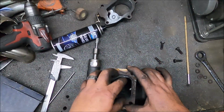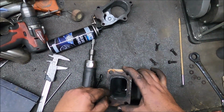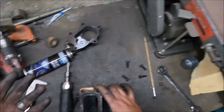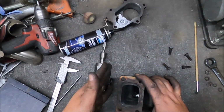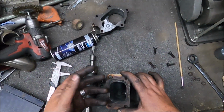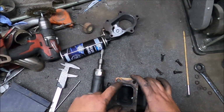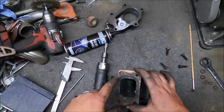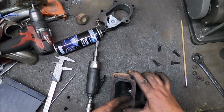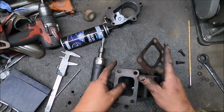Because the gas is flowing out, too big is better than too small. So it don't matter if I went slightly over, but things have to get bigger on the way out. Well, just as the flow goes forwards, it needs to keep going bigger, or at least a smooth reduction, because that's where the flat surfaces are bad. So going into here, it needs to be at least as big as the previous area. I'm just going to go off the gasket because I'm not sure of the previous area yet, but the gasket is technically a maximum, so just a little bit more on this side really.